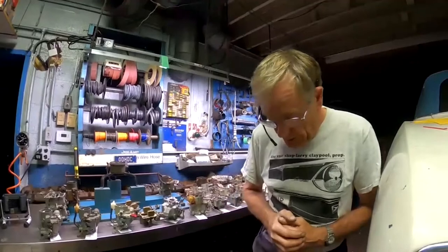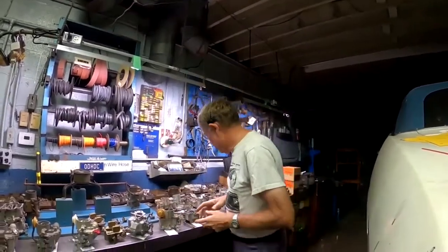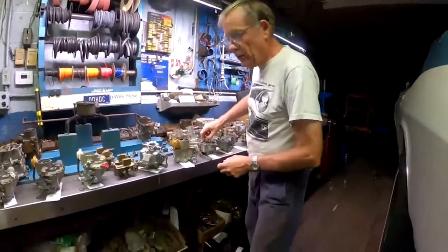So Chevrolet thought about that. Well, if we just put a bigger jet in the car like we did for that service fix, that really fixes the problem of poor performance, but it also makes the car use more gas, because when you change the main metering jet, you're going to be using more gas all the time, not just when over 60 miles an hour, when you might be throttling it pretty hard. You're going to use gas anytime you're off of idle. You're using more fuel because of the larger jet. So Chevrolet decided they would install a power enrichment circuit.